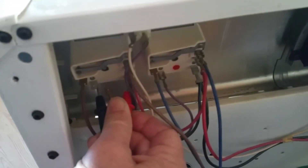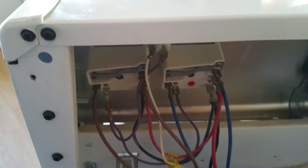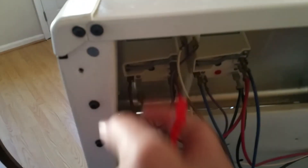Put the burner off. Looks like we got lucky in this case because we're getting — let's get the wires on there. We got 0.6 ohms between those two points. We got lucky — the very first one we checked was the burner switch that is bad. So we're going to replace this burner switch right here, and that will take care of the element-on light issue.